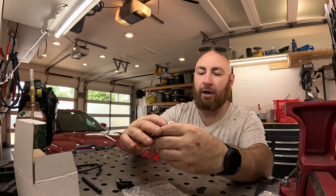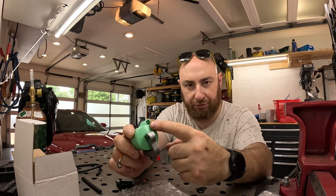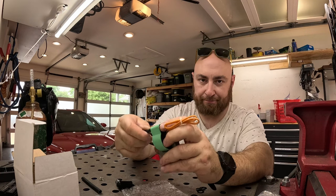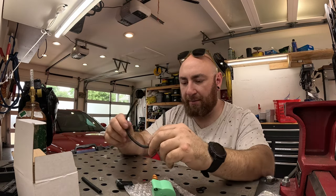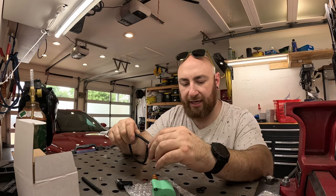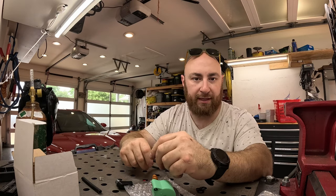This is the boot, this is the end the spark plug goes into. There's also a protective sleeve that comes with it — this will go on our spark plug wire. On the coil side you can see where the coil screws in there's a threaded wood-screw type deal, and what you'll do is just thread it in there when done to give you electrical connectivity. This is a very old school way of doing this. I'm going to assemble the wire part on the bench and then install all four coils on the motor.